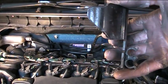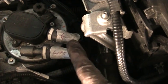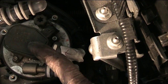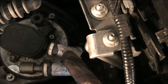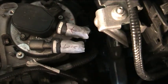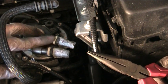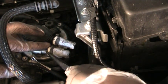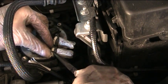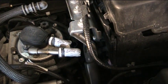Make sure you clip the hoses back in when reassembling. Before removing the fuel hoses, I've put masking tape on them to ensure I put them back in the right order. On the top you can see a cap with an arrow marked showing fuel going into the filter — I've put masking tape with an arrow in that direction. On the other I've put 'left' so I know it's on the left-hand side. To remove the quick-connect fuel hoses, get a pair of needle nose pliers and push the white strips down, then push the fuel hose off.